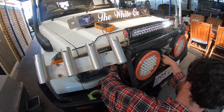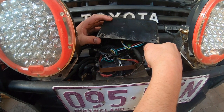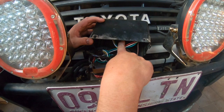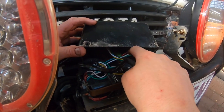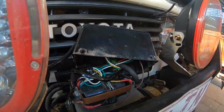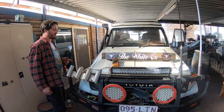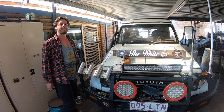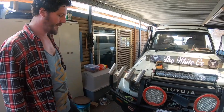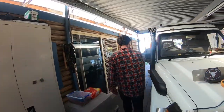If you want to set up a remote switch, you'll have to duplicate all these wires and run them into your switch. You'll have to run a brown wire tapped off one of your solenoid pack earths, run another cable to ground, tap off your power, and your winch in and winch out — or power in, power out. You'll have to tackle each one of those wires and run them into the cab. You don't need to tap the earth — you can just earth it in the cab somewhere. The big problem was that you needed to earth it both at the switch and at the solenoid.